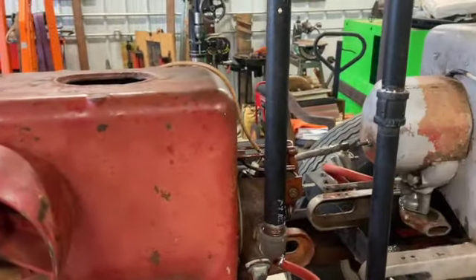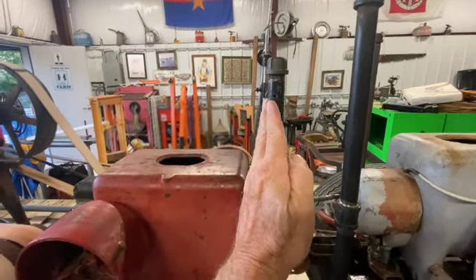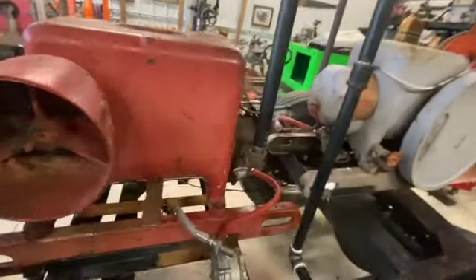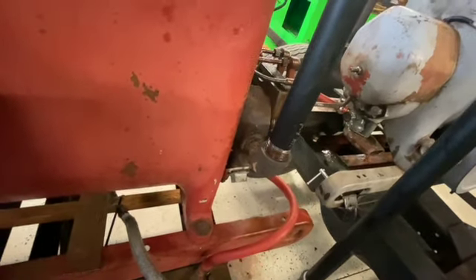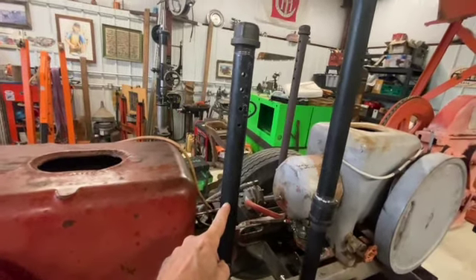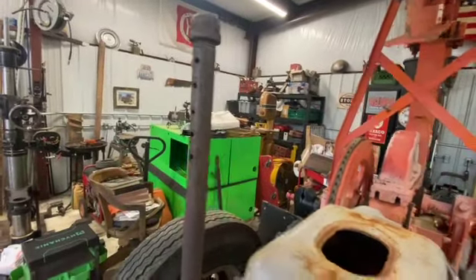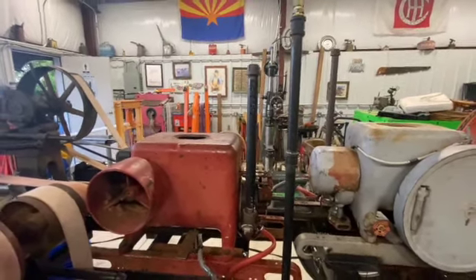I removed the china cap exhaust because every time I walk around this trailer, that exhaust would just go — this thing has got to weigh 20 pounds at least, it's heavy. I've got the nipple and the elbow screwed in as far as I dare. This is pipe thread, it's tapered — if you screw it in too far you run the risk of splitting the cast iron head. So I got some one-inch pipe and a cap, drilled it just like the existing exhaust on the smaller engine, and put it in there. That's the new exhaust.